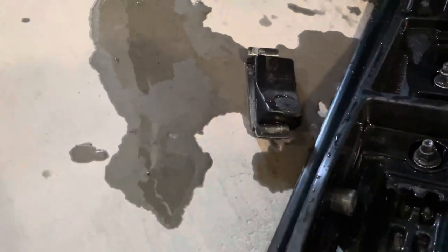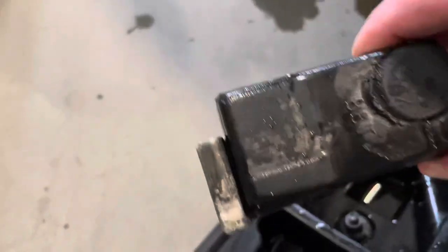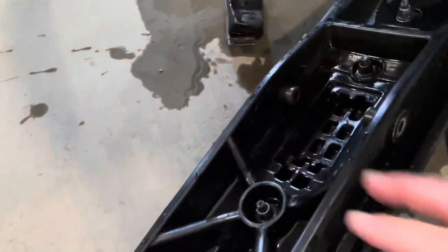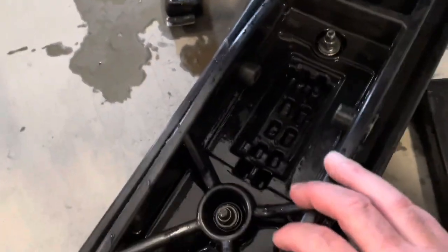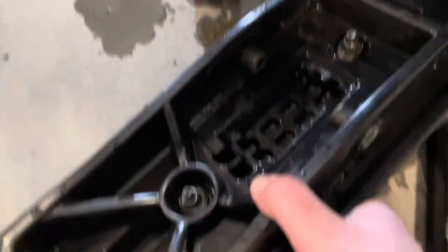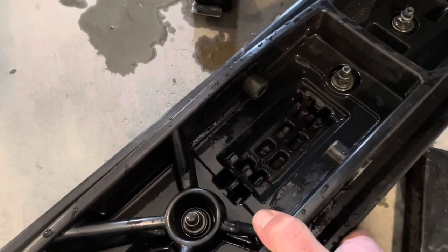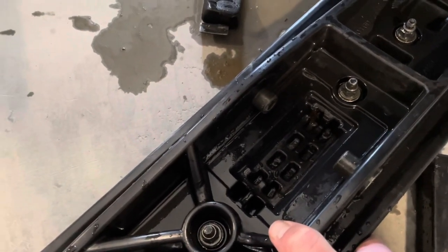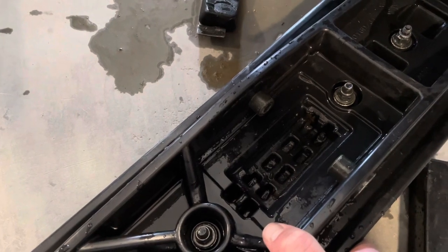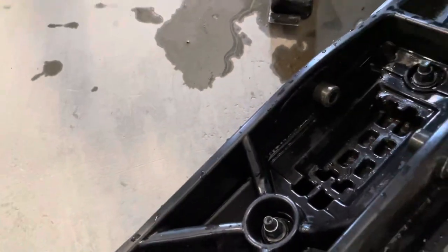Okay, so you also have the little rubber bumper. And it's got a metal plate. Make sure you put it on so the ramped portion's facing forward. Maybe it says on there. Sometimes they do. Polaris ones do, or they only fit in one way. I can't remember, but anyway, it's kind of screwed up. I think you could on this, and then your skis are gonna flop kind of funny. But you can see how much that's recessed in there to make room for the bottom of the strut so the ski can articulate. So if you do try to fit wider aftermarket skis, just keep that in mind. I think I looked at putting on a set of CNA XTs, I think. And were they 8 inches wide? And this wasn't recessed and it wouldn't fit.